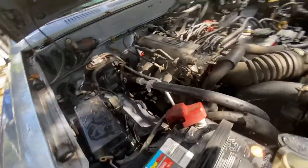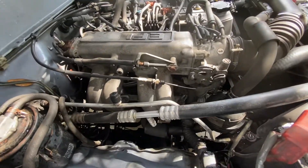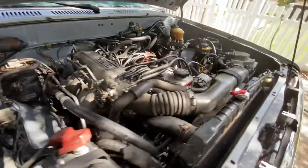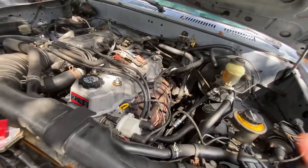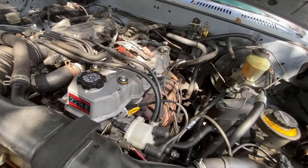They go out all the time, they make a groove, they get worn out, and they leak. Common crap on these engines. Now I know where to fix. Also going to do the pan gasket, because I've been saying forever I thought it was the pan gasket, but my little leak test, you can see that it's coming from higher than the gasket flange itself.